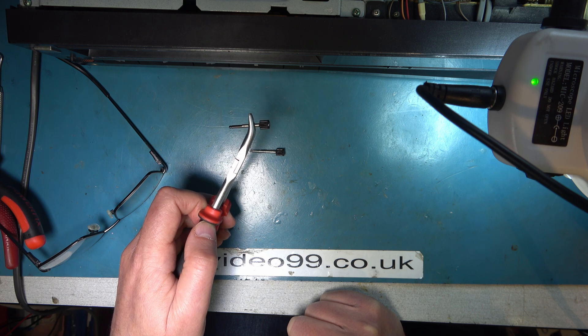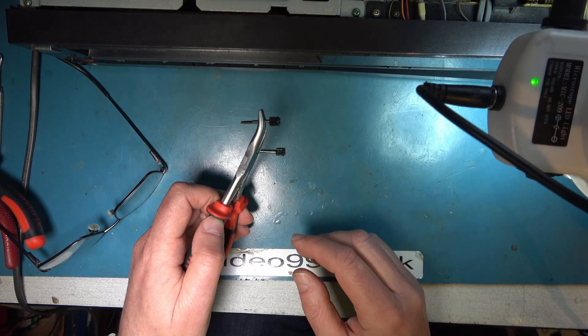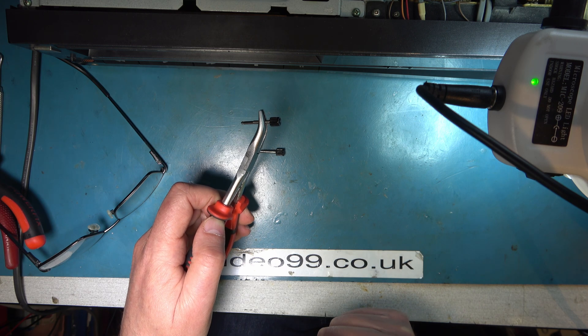So all I really can do is glue that on. Well, I glued it together but I'm not happy. The split of course means that there's an excessively wide gap on one tooth of that gear and I think the tooth spacing is too wide on that gap — it just isn't going to run. I tried running it against the plastic gear it's supposed to mesh with and it's jamming up every rotation. So I don't believe that's going to work for us. I obtained another one of these gears from a scrap video recorder and it's also split but it was nowhere near as bad, so I think that one's serviceable. I've applied some glue on the end to strengthen it and hopefully prevent the split from getting any worse, but it looks in much better shape so I think it will mesh properly with the plastic gear. I think we've got a chance of making that work.